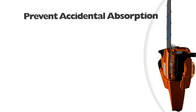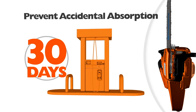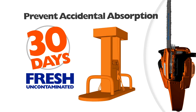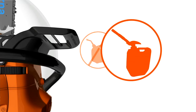Other ways to prevent accidental absorption of water into gasoline include purchasing only enough fuel to last about 30 days — this helps assure that you are always using fresh, uncontaminated gasoline. For two-stroke engines, only mix enough fuel that will be used within the next 30 days. In order to store the fuel with as little exposure to air as possible, avoid containers with vent caps. Look for containers that are airtight and that also provide tight seals around the cap.